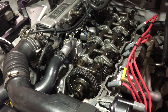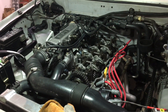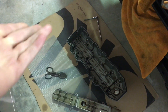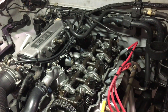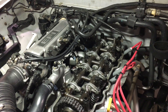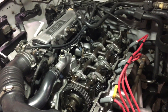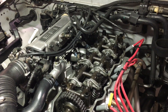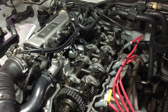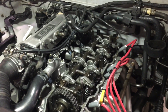I'm really curious to see what the final resolution of this is going to be. I'm also going to mess around with the orifice restriction here and try to adjust the vacuum levels. On my return trip the truck seemed to lack power, but I stopped at the gas station and adjusted the PCV system to get around two or three inches of vacuum while driving — and suddenly I had power all over the map, passing people going up a couple-thousand-foot incline like they were standing still.